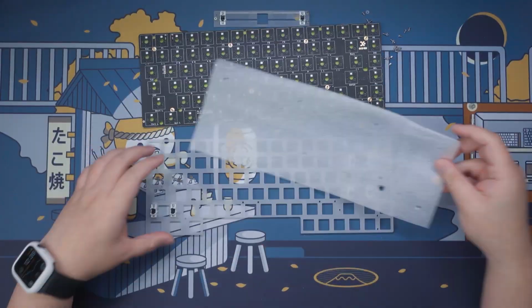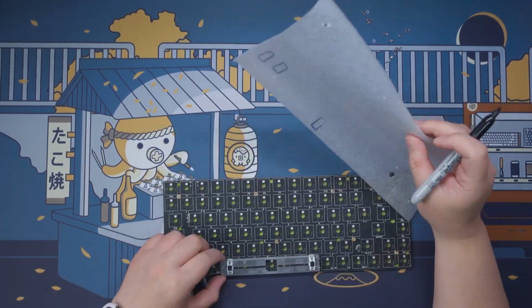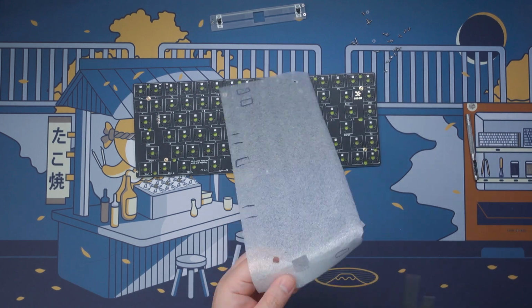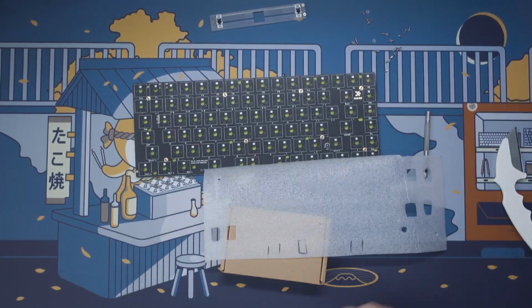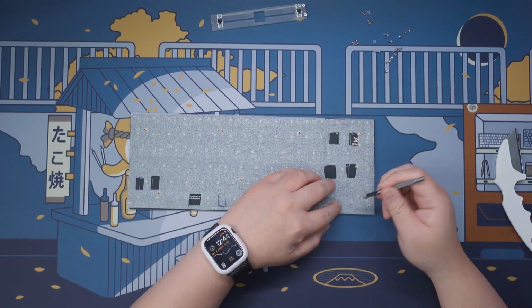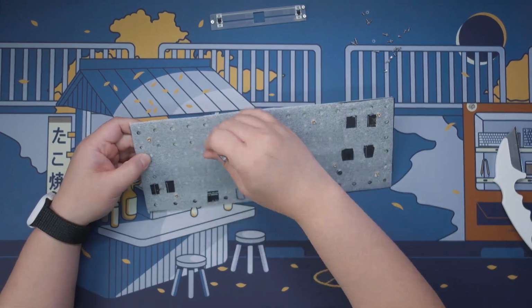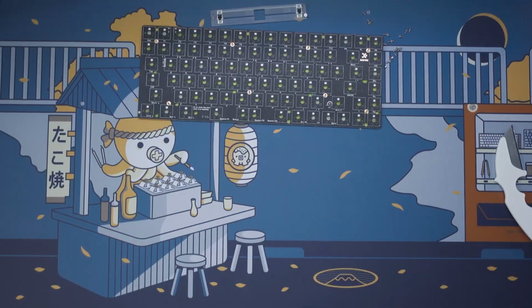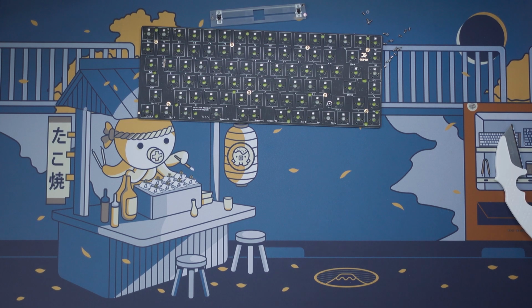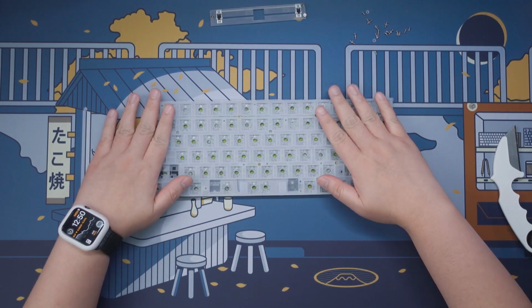First, you need to consider that this mod could possibly make your PCB and plate combo thicker than it should be, and in some cases, especially with thicker foam, the switches might not be as secured or might get bent during installation. And if you use flexible plates like POM and polycarbonate like what we have here, sometimes the plate can get distorted, so you should be careful when doing this mod. The PE foam mod by itself or partnered with the tape mod will ultimately make the keyboard sound even more deep and poppy. The execution is a little bit advanced compared to the tape mod.